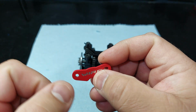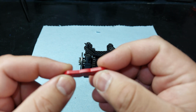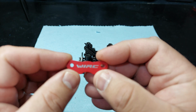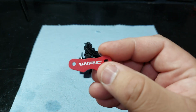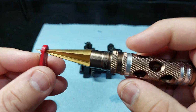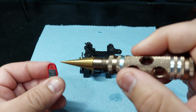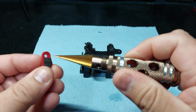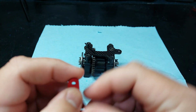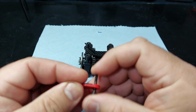It's just this side. That's what I've noticed when the brakes engage. Whatever side this mounting hole's on is the one that hangs up a bit. I don't know if that was by design, I just don't like it, and I feel it makes the brake engagement uneven. And if your brakes aren't consistent, I don't see how your lap times would be consistent. So the way I do it is I get an old body reamer. This is an older one, I never use my good one on this stuff. I put it in the hole and gradually, real lightly turn it around. You can see how it flakes off, right? I remove it just enough so that the screws pass through without any issue. Now there's no issue whatsoever, right?